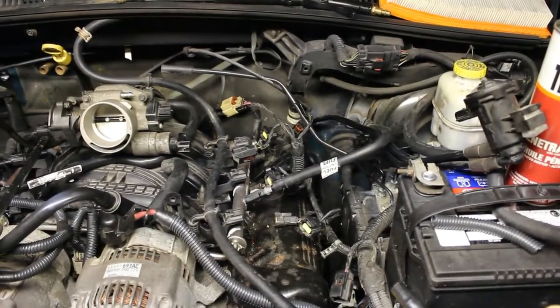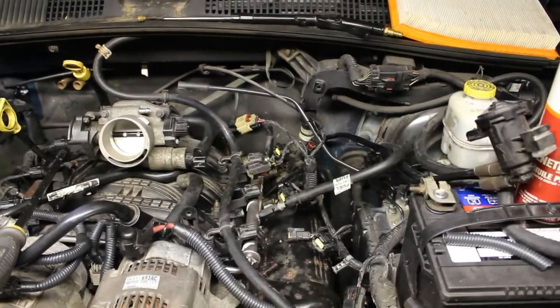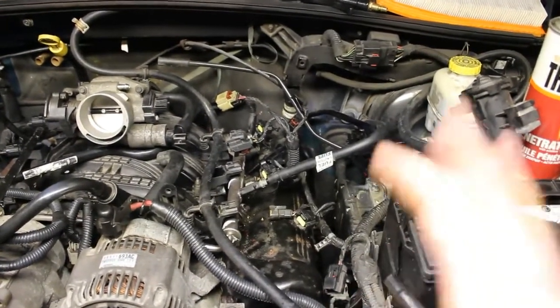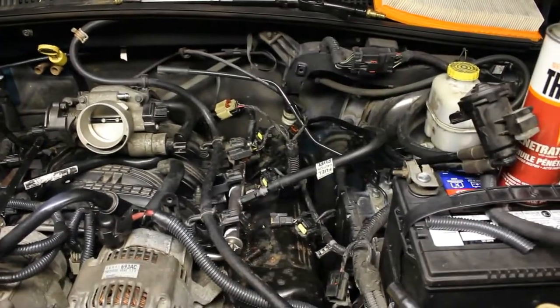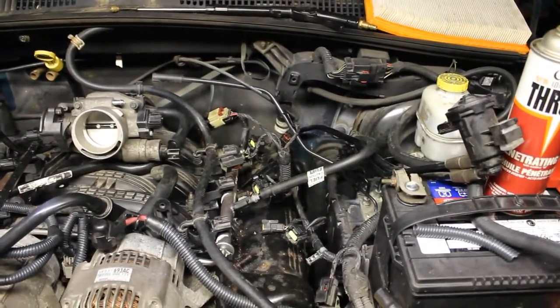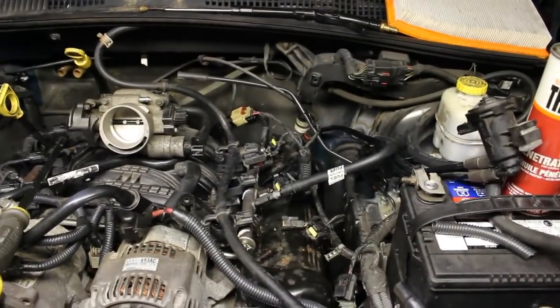It's always a good thing to do. Check the connectors out, all the wiring. Make sure it's all good, the tape is good. And I think it's the best thing to do in this scenario on this side. It doesn't take long to disconnect those connectors and move them off to the side, rather than risk damaging the wiring. This particularly applies to your injectors and the coils there.